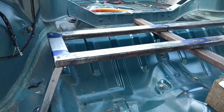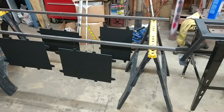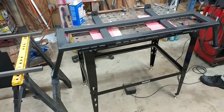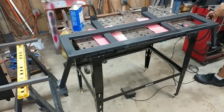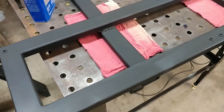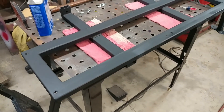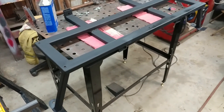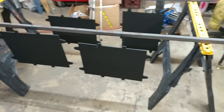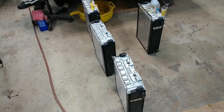That's where that's at at the end of today. All the parts for the rear battery pack have finally been cut, welded, assembled, painted — just a couple coats of black Rust-Oleum. This piece we had some trouble with because I used the MIG welder for it since I was out of TIG gas, and that actually bent it out of shape. So we had to spend some time putting it in a hydraulic press to actually straighten it out. These other pieces went pretty well. Now I can assemble them with the coolant plates and the last four battery modules into the rear battery pack.